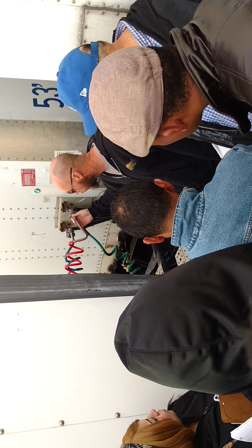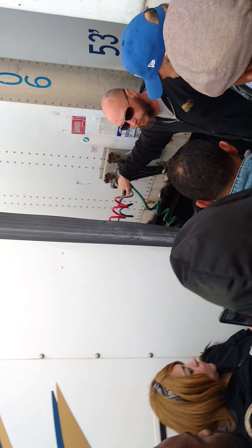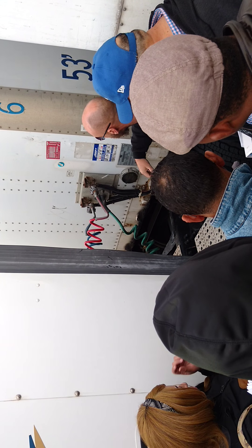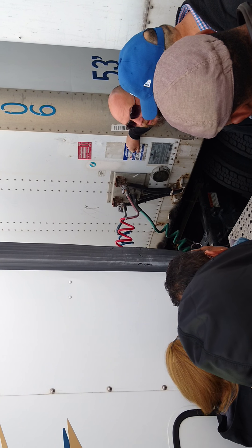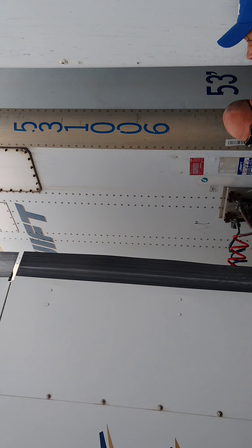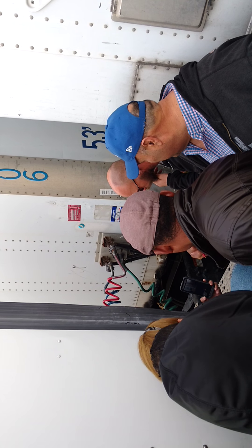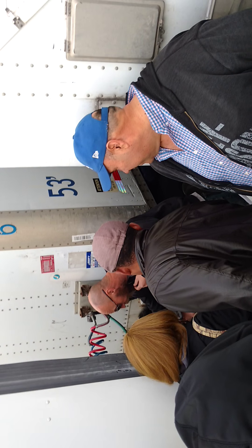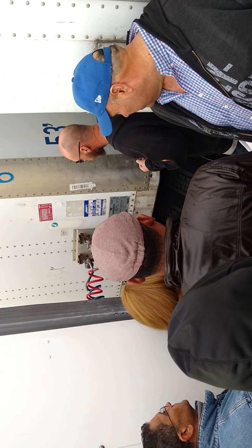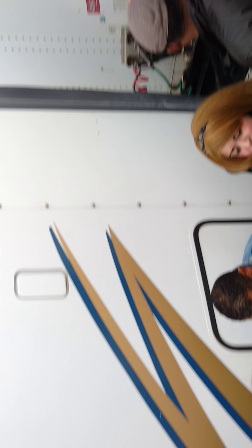Next, any clearance light — it's about waist high and it's amber in color. We check these for broken loose or missing, good working order. It has to be amber in color, and it has functions. On this side it'd be a turn signal, four-way flasher, and running lights — that's on the test. Then we have steps — same thing I would check those steps for. There's a catwalk — I'd check the catwalk the same way.